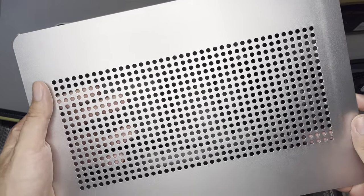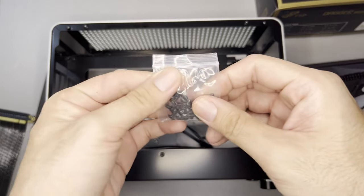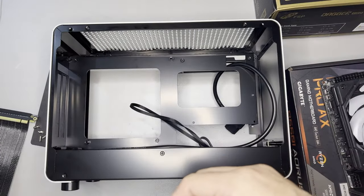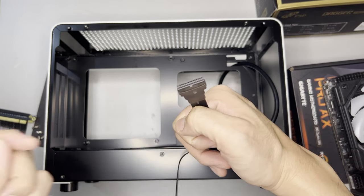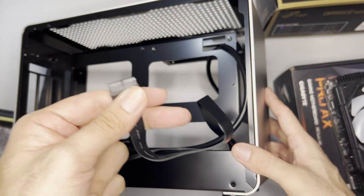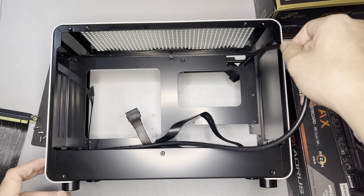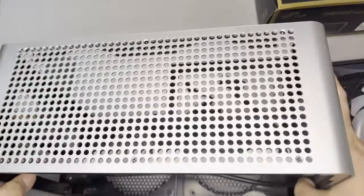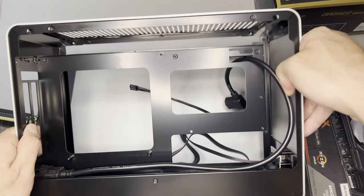The finishing is more like ZZ-AW — the color, style, and feel. Inside are some screws, standoffs for the riser. There's also the connector for the power switch and LED, and the USB-C — it's 3.2. So the front panel is USB-C, but the header they're going to use is the standard USB-C, which is good — no adapter needed. Then there's the extension cable. At the bottom, you'll see two mounts for 120mm fans, and for the top as well, it can house two 120mm fans, which is good in terms of cooling, at least in theory.